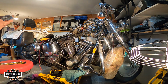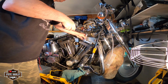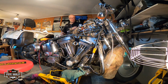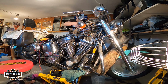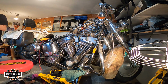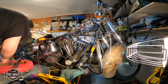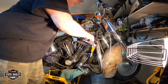Take the extension out. Alright, put the extension back in. Alright, that's it. Okay, let's do the 3 ones now, the 1/4 of an inch. Let me get it ready. Okay, these ones are 10 to 13 foot-pounds. I have hand tied them. I'm going to start with this one.